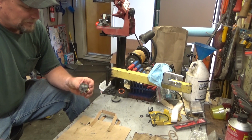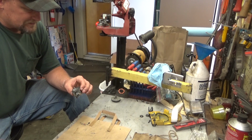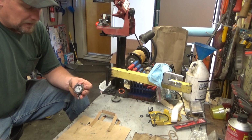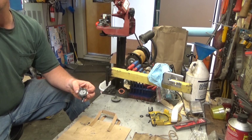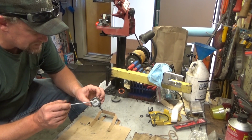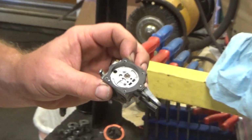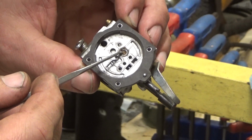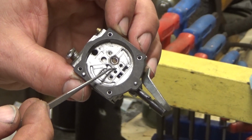Now this carburetor is pretty tore apart because it was a parts one. I don't honestly remember why I started using it for parts, other than maybe because I needed to. Doesn't matter. The K10 HDC kits, I don't have one laying close by or I'd grab it, has just about everything but the check valve. I guess I'll zoom in real quick here for grins. So the check valve is buried under this screen and retainer ring. Now what this really does, we'll talk about in a minute.